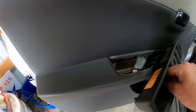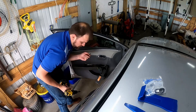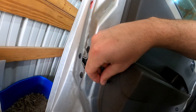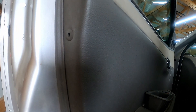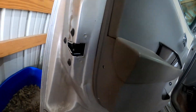You do not need to disconnect any of the wires except for the trunk button there. That's all the major hardware. There are two of these little push-button tabs here — use a bolt to poke the center dot, which presses in about an eighth of an inch and disengages them. This pry tool is really handy for that — you could use a flathead — pull them out, don't launch them too far or they'll break. Pry these two out right there.